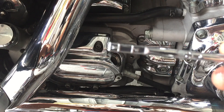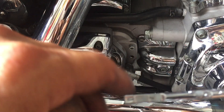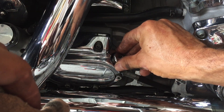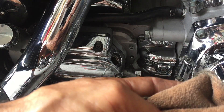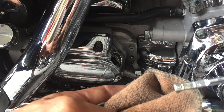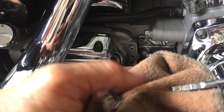As you see, we like to put it right before the F. The book says place it in, do not thread it down, have the bike level, pull it out. The oil is too clean to really see it, but it's right before the F. Now I will ride this bike and I'll check it again.